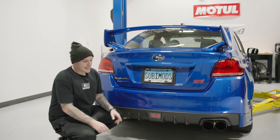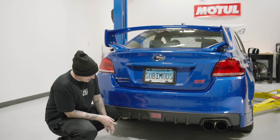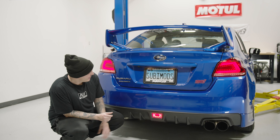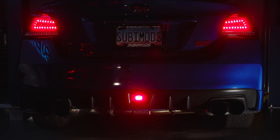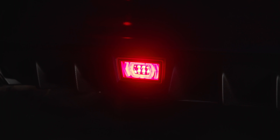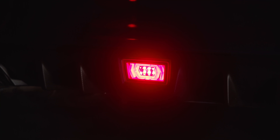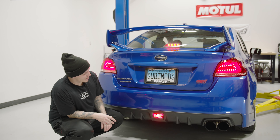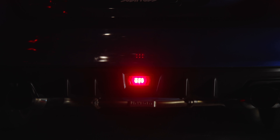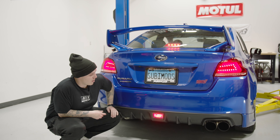Now that the trunk's back together, the wiring is done, all the clips are in, and the light is secured to the bumper — we're going to test it. Lights on: that Cyclops bar illuminates bright red, looks awesome when combined with an aftermarket set of taillights. Brake light: you'll get eight hyperblinks on its default mode. The big feature of these is you can also change that mode — to do that, it's simply foot on the brake and a couple quick flicks of the headlight on and off. We'll pull over to the front of the car so you can watch how to program that.